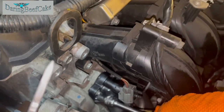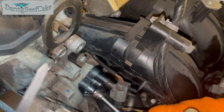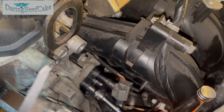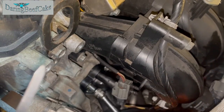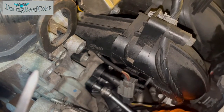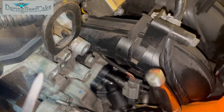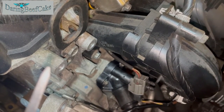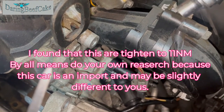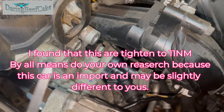So now I'm gonna use my ratchet to get those in. Just remember, these bolts are just 8mm. They're a bit like butter, so you can damage them very easily. Once you feel with your ratchet that this has gone in enough, that feels tight, then that's pretty much as far as you need to go. You don't need to tighten those bolts any more than that. I haven't got the actual figures in newton meters of what they are, but they are just 8mm bolts, so it's not gonna be a lot of force. Right, so I'm just gonna put them in and we'll come back to it.